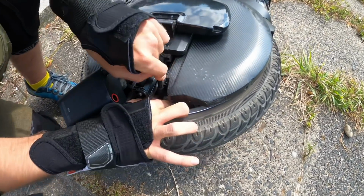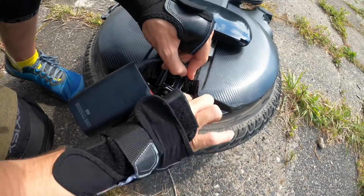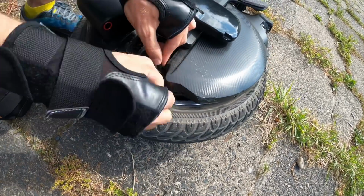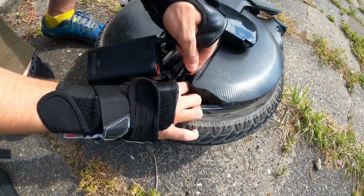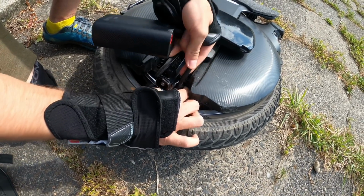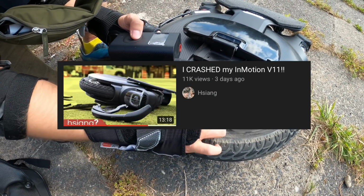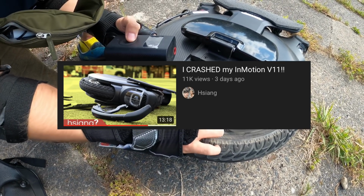But the suspension in the InMotion V11 does also come with a small amount of setbacks. For example, it's really difficult to access the valve to your tire, and the valves at the bottom side of the damper are really exposed, and if you hit something, well, this might end up badly. On the top of the shell, there are also 2 additional valves to the negative chamber, and if you fall and somehow damage the top like Sean did, then this will turn out very expensive as well.